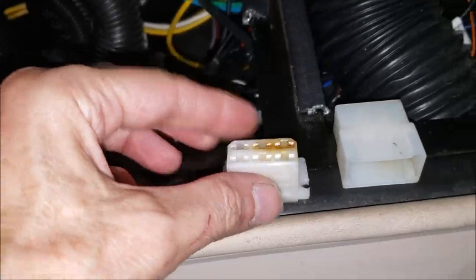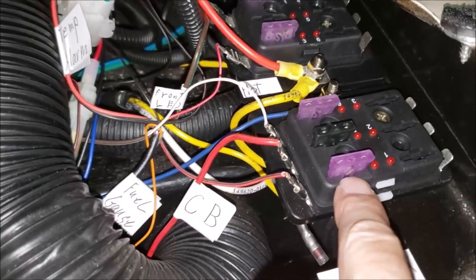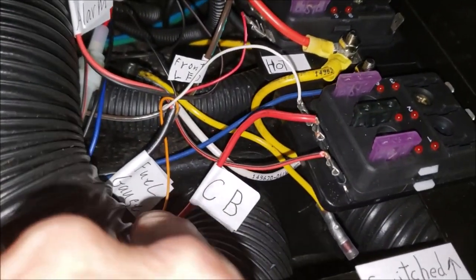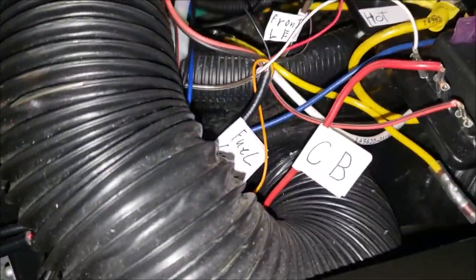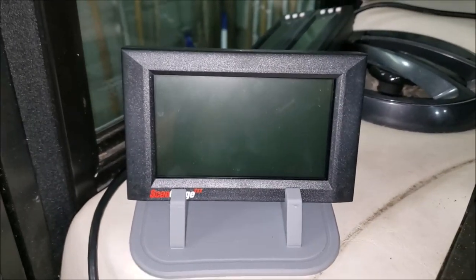Just to recap: got rid of that plastic piece that was melting on me, giving me trouble — that's all done and it looks good. I went in here and cleaned up all my individual wires — I had a wire nut tying all my hots together. Got everything separated with these little fuse holders you can get on Amazon — pretty nice, and if you blow a fuse it lights up to tell you. Each item is individually fused: my CB, fuel gauge, temperature alarm, front LED lights. This bottom fuse block is switched and only gets hot when the key is on. The top block is hot all the time — that's what powers the cigarette lighter circuits which run my cameras, LEDs, and accessories I want on even with the ignition off.